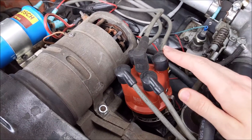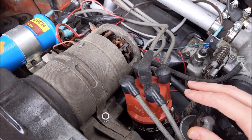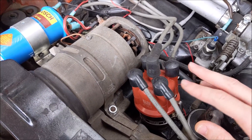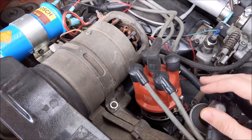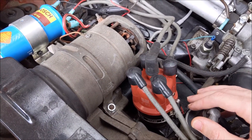This distributor does two things. It replaces ignition points, which is great. Pertronix has done that in the past with other distributors, and it also changes the fuel injection trigger points to an electronic signal as well. So you don't have to ever really touch it once the ignition is set.